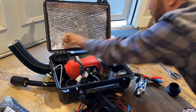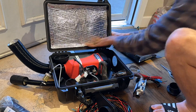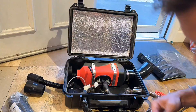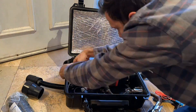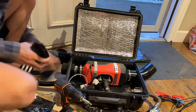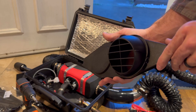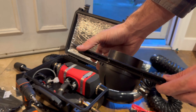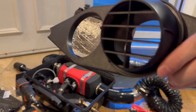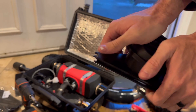I started by taking some rough measurements, cut it down to size, and just stuck it right on the lid and any other places I thought needed some thermal reflection. Now it's time to start making the actual modifications because the outlets on the 2-kilowatt unit are smaller — a 2.5-inch outlet and inlet — and I need to make those fit into my new BC Off-Road Shop zip-in diesel heater outlets. These are made by a fellow GX Off-Road member, and I'll link them in the description along with the diesel heater unit from Vever.